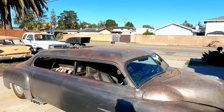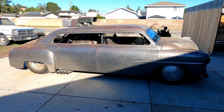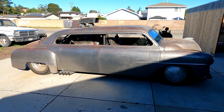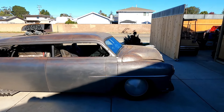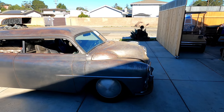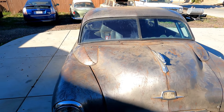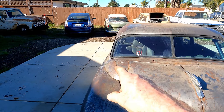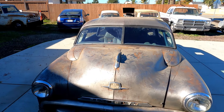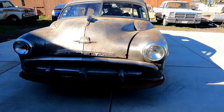I really wanted a car with the engine in the wrong place. The four-door body is about 10 inches longer than the two-door, but the body and frame have not been lengthened — the frame is stock. It's a long wheelbase car to begin with, but I shortened the front end about 18 inches because I got into the whole cab-forward look. Because of that, the hood got narrower in the back, so I had to build these little humps to fill in the open gaps, and I wanted them to mimic the hood and have a nice flow. I love that grille — it looks kind of like a flounder.